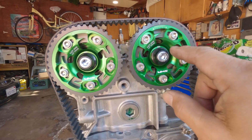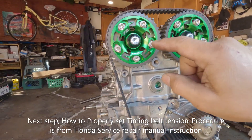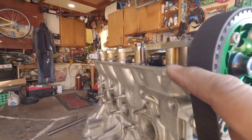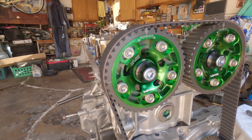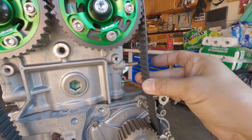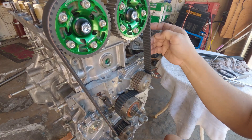The camshaft needs a little bit of adjustment — that's why I have the adjustable cam gears. Pay attention to the sloppiness of the belt. I'm going to move the cam gears about three teeth — one, two, three — right to this point here, and line that up to the flat side of the cylinder head. It doesn't have to be perfectly precise. Now check out the tension — it's a little sloppy here. What happened is I put tension on this side and made the belt relax on the other.